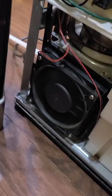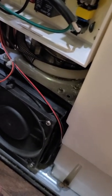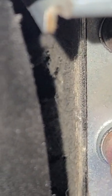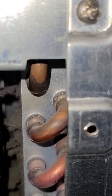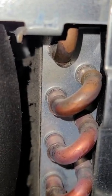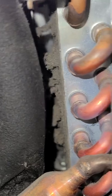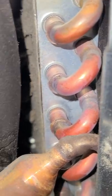Now I spun the fan around and turned it back on — it's just four screws, really easy to spin. It seems to be pulling in more air. The back of my unit had a large amount of dust caked on it; I blew it off as best I could from in here. You can see how the fan is blowing the dust out of the inside of the unit now. I prefer it this way because if dust does cake on it, it will cake on the outside where the fan is, versus on the back side where you can't really get to it.